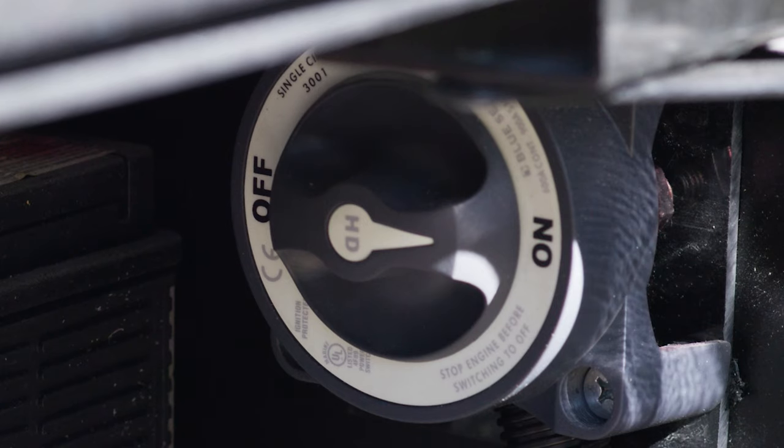Let's have some fun in our wet bay. We have our exterior shower — you have your hot and your cold. Remember, your water pump has to be on if you are using this when you're not connected to city water. But when you connect to city water, you do not need your water pump on. This is going to be a great tool to have when we hook up our plumbing here.